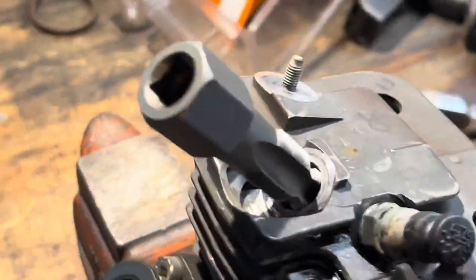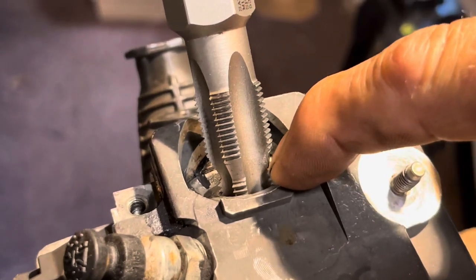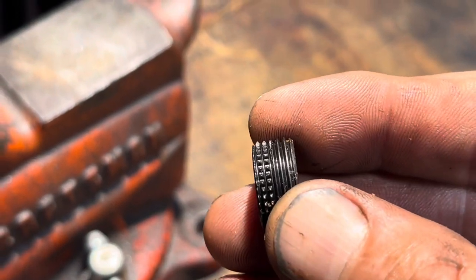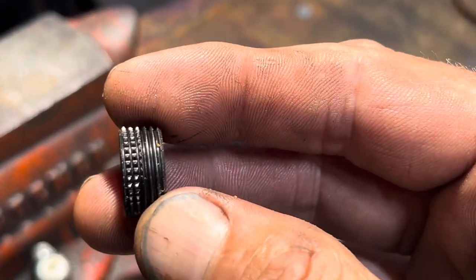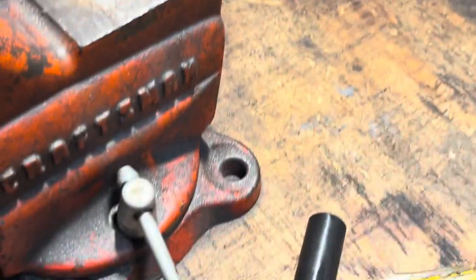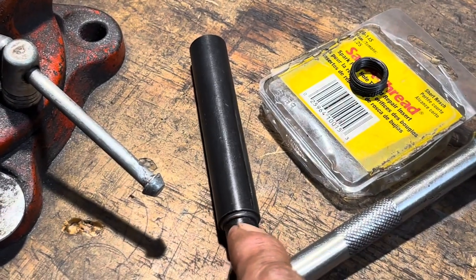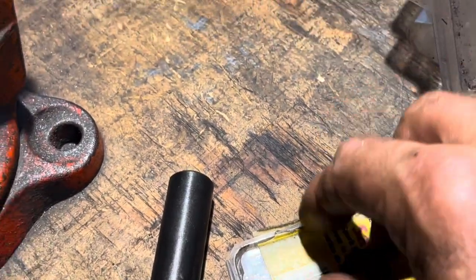This tap from this kit - the Save-A-Thread kit - you get this dual-sized tap. It's supposed to fit so you can chase regular spark plug threads, but that's your starter. It tapers up and cuts threads for this insert. Up here at the top, those last couple of threads have little grippy feet on them. They make these in three different thicknesses: short, medium, and long. Use the shorts in chainsaw cylinder heads - the mediums are too long. And there's your install tool.